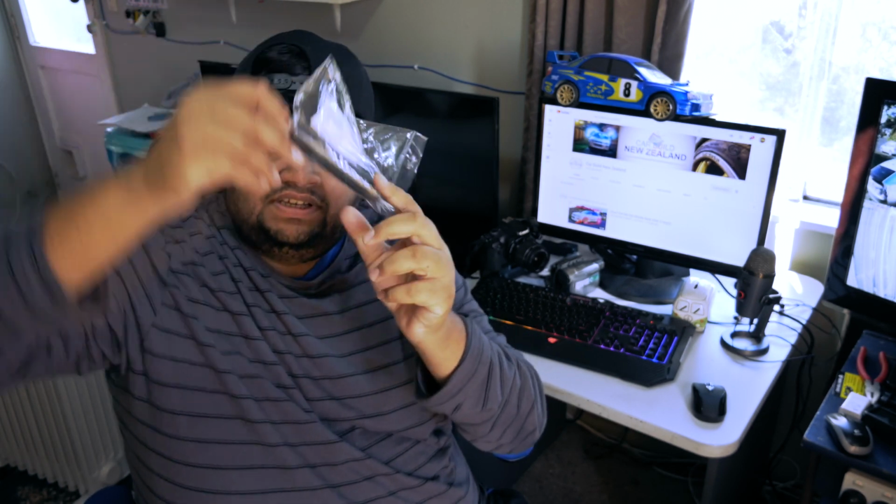This is the turbo pipe that drains back to the car, and there's a metal piece coming from the turbo, and then this goes there, and then there's another metal thing here that goes there. The one currently on the car is about 23 years old. It turns brittle and hard, and they start sipping out a little bit of oil, and then it burns off, and then you have this turbo smoking, and you're like, what the hell is going on? So this little thing is causing us a headache, which means the turbo has to come off. Now I need to order new turbo gaskets, inlet and outlet, and basically redo the whole thing.